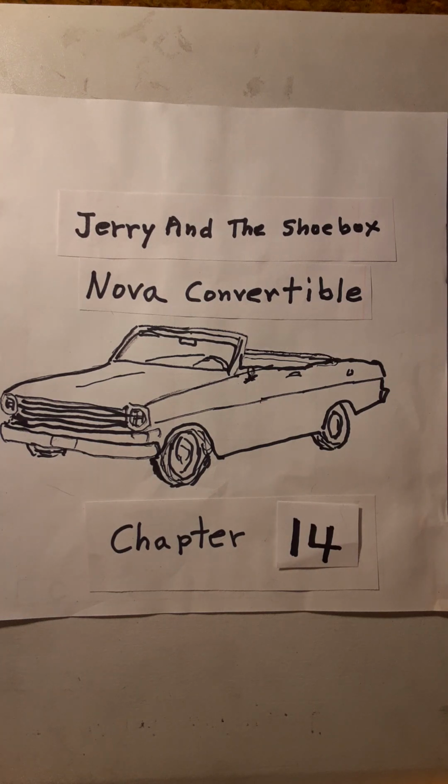Now, before you take the convertible top frame up to Alex, spray each joint with silicone lubricant and then work it up and down so everything moves smoothly. I don't know if that would be good to do with the canvas top installed, cautioned the mechanic. Yeah, that might hurt the canvas somehow. It would be best not to take a chance, agreed Jerry.